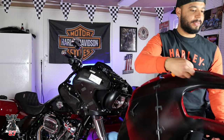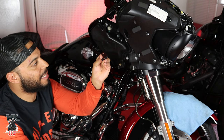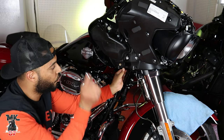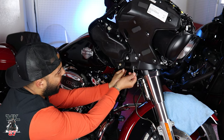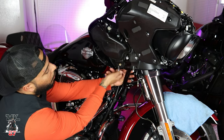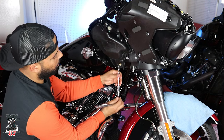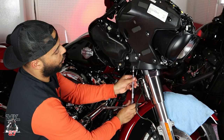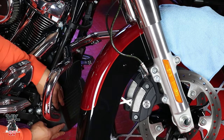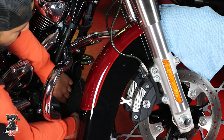Starting from the right side, we take the spoiler bracket mount, wrap it right behind and to the front, and use two of the provided screws to fasten it in — just snug, not overtightened. Then we take off the radiator cover in the front because a new one is included for use with the spoiler. It should just pop right off.